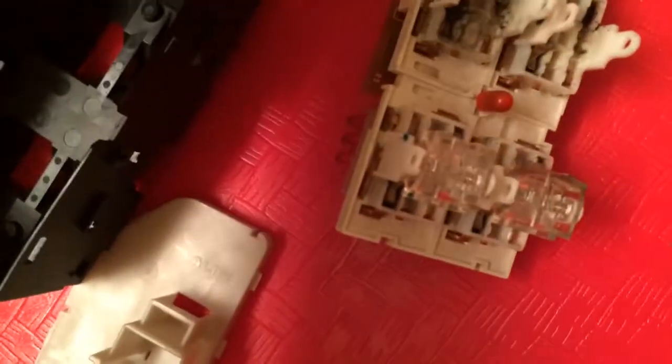So next, these are the actual rocker switches, up and down. You will remove those by prying sideways with the screwdriver here. Just prying lightly and you'll pop those right out, and you'll notice that they have these little plastic points in there, and there's a spring inside there. It actually has grease on there, so when one of them is melted, you can actually replace it with another switch that you wouldn't normally use, or you can reshape it a little bit and stretch a spring out, and you can see that it just comes right out.